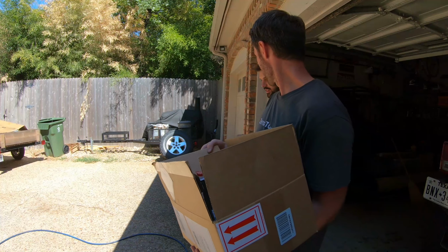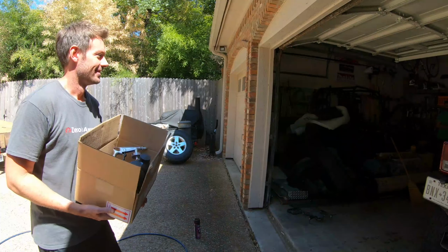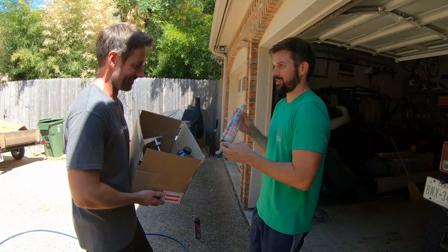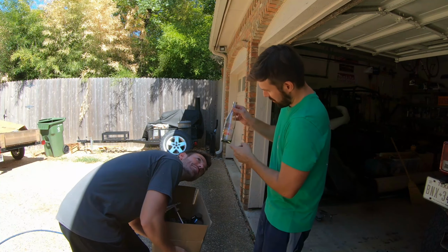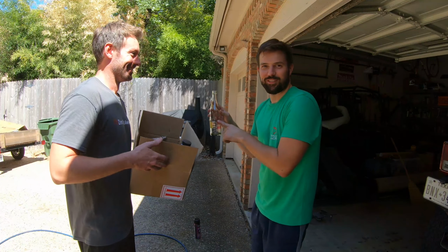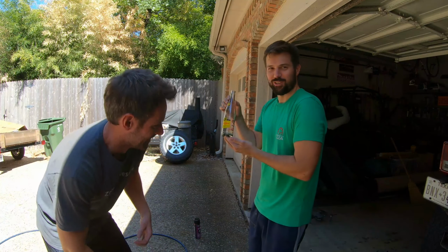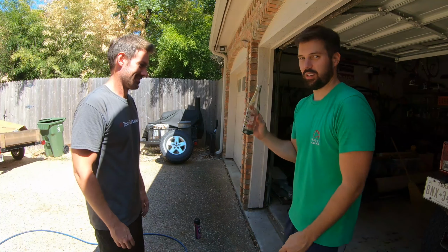Hey, would you like to use my Measure Chico? Oh, I don't know what a Measure Chico is, but it sounds amazing. This is my Measure Chico. It's a bottle of Topo Chico with convenient ounce markers on it. What is this? 2 ounce, 4 ounce, 6 ounce. What is this black stuff on the bottom? Oh, that is 50-to-1 outboard engine oil. When you have to mix 6 ounces of oil to 2.5 gallons of gas, you make yourself a convenient Measure Chico. You saw it here first, Internet. I'm not gonna dispute it. I'll rinse out the oil. Yeah, that's probably a good idea.